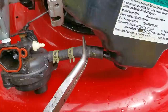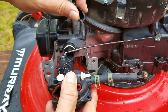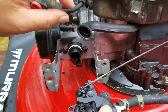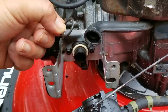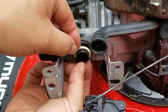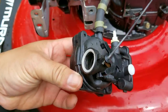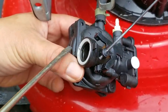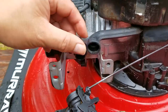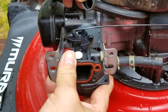To make filming a little bit easier, I'm going to disconnect the fuel line from the tank so the tank will be out of the way. You don't need to remove the fuel tank if you don't want to — this is for the sake of filming. Now it's at this point that I started to realize something. When I tried to stab the carb back onto the intake pipe, I noticed that the o-ring and its retainer was still on the pipe. This does happen sometimes and you'll need to take it off the pipe and put them back onto the backside of the carb. After taking off the o-ring and the retainer from the pipe, I found out this set wasn't from the carb we were trying to install — the carb already had its own retainer and o-ring on it. So where did this set come from? The answer is more than likely the original carb, meaning this one must be a different carb.